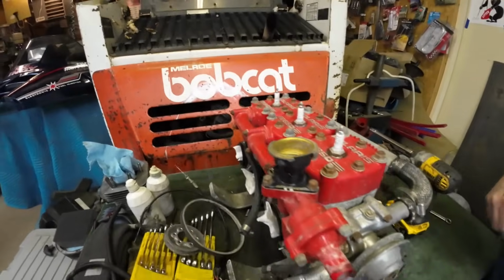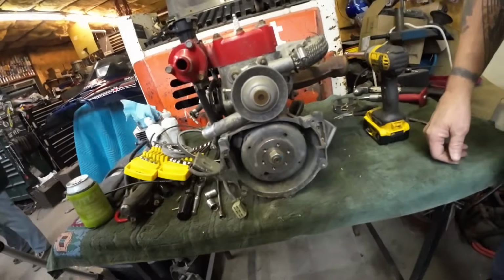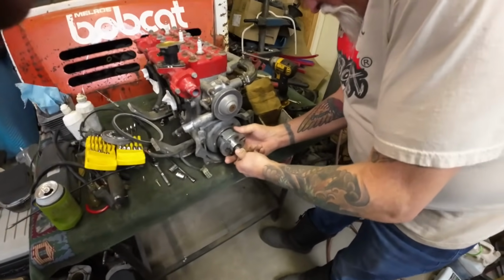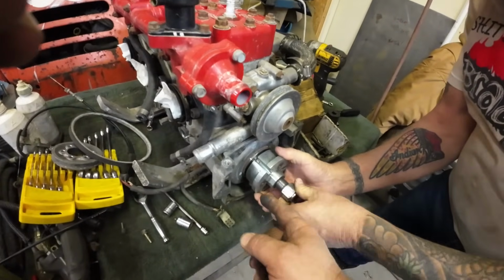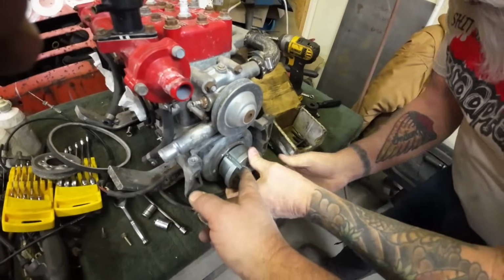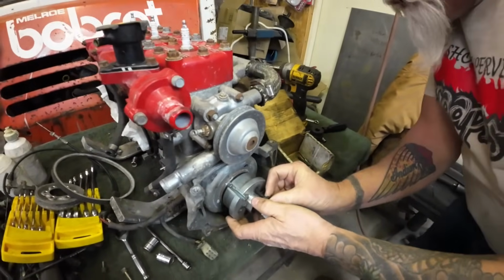All right, we're going to stop the camera for a minute and get the puller and set up to get this nut off. All right, Lonnie's got the puller, an SLP maximum duty puller. He's going to run it in until it makes contact and then just back it out a little. This flywheel has 6 holes. We're only going to use 3 bolts, so we're going to use the holes, not the slots, because the holes line up.